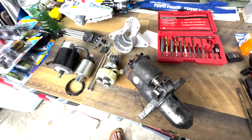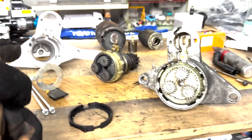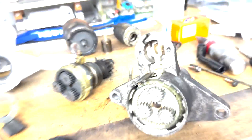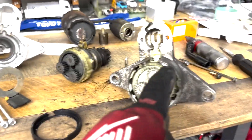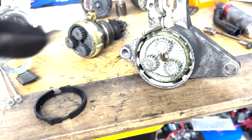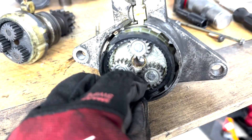I've taken the guts from the old one and put them in, then took the guts from the new one and put them into the old housing. The RX-8 starter won't fit the FD - you just take the guts and put them in the old housing. Now I'm going to take this piece - there's a fat end that pretty much just hooks on - and feed it in, then the gasket goes on in there.